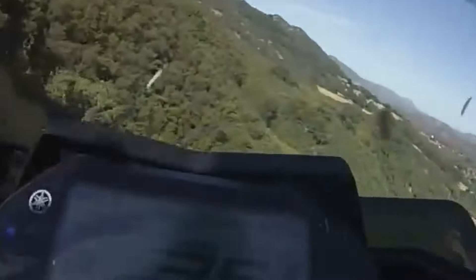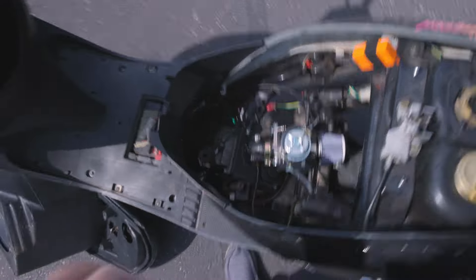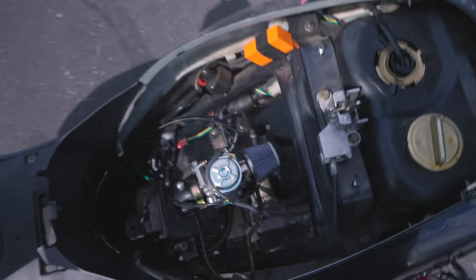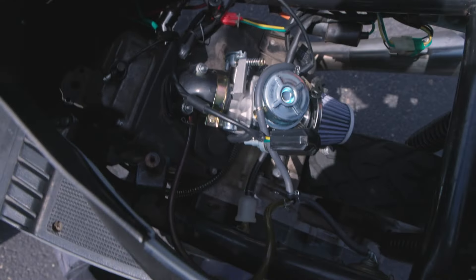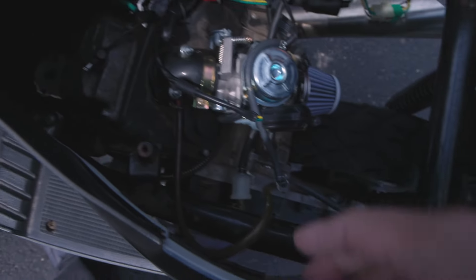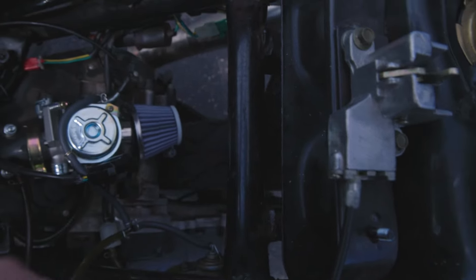It's a terrifying crash. That didn't happen — clearly, I still have the scooter. I did do a couple things off-camera yesterday. I wanted to see what would happen. Somebody left a comment saying you gotta put this vacuum line — plug it up. I tied it into this line here, and it actually did much better. So you guys were right on that.